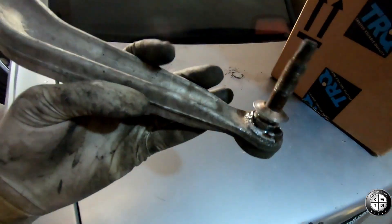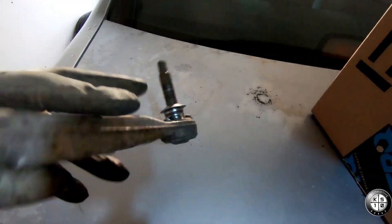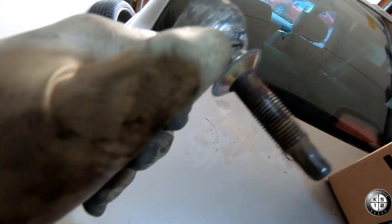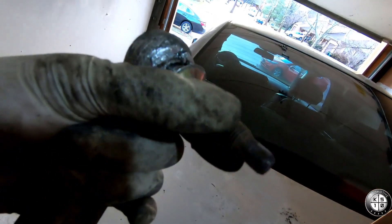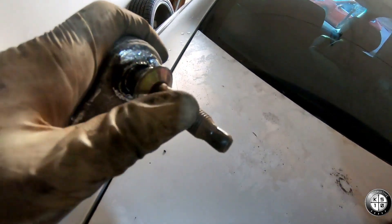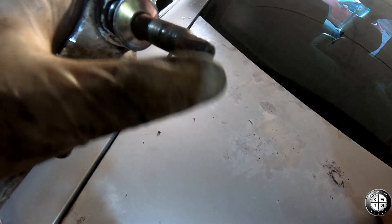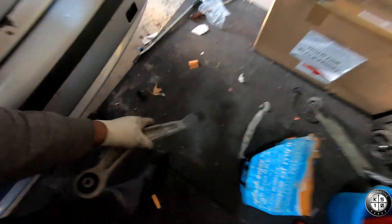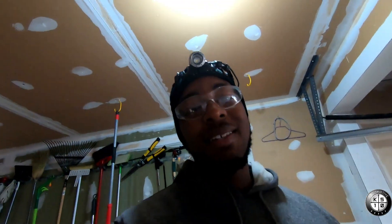This thing was really hard to do because the ball joint kept spinning. So what I did was use some vice grips to kind of bend the sleeve over here so I can wedge the ball joint and stop it from spinning. You can also grab the tip right here with like a 10 millimeter and hold it, but it broke one of my sockets trying to do that, so this way worked. So now we're going in with the new ones — these are the two old ones. There's a lot of play coming from these ball joints. I'm tired but I got to get this done.